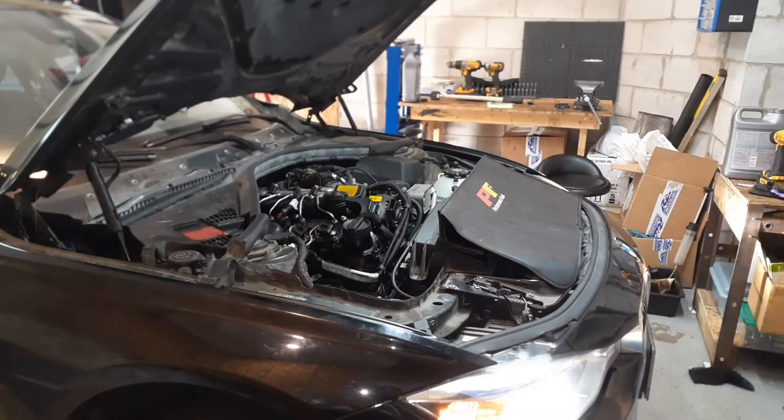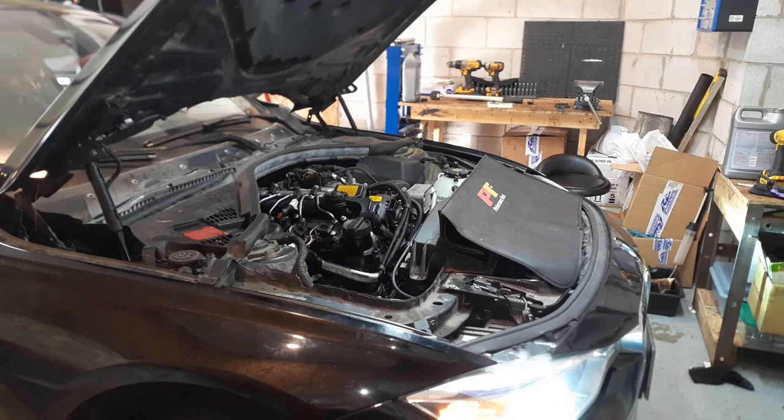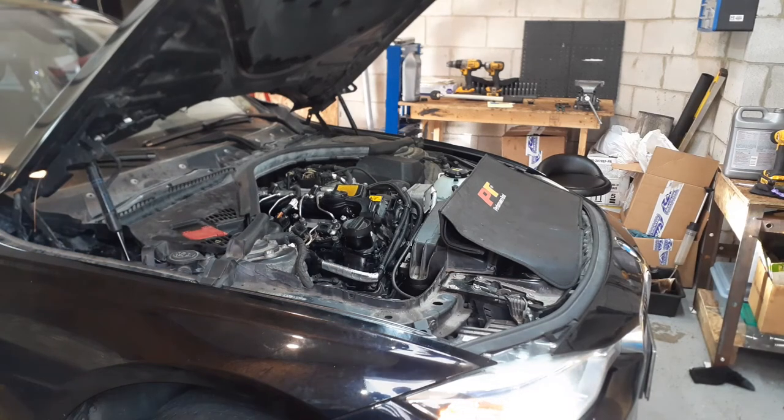Now that the vehicle looks like it's completed its cooling cycle, I'm going to turn the key off, disconnect the battery charger, close the trunk, and start the vehicle. Make sure there's no lights and let it run to operating temperature. We're now going to let the vehicle run. There's no check engine lights till it reaches operating temperature. Then we'll lift the vehicle up and double check everything.